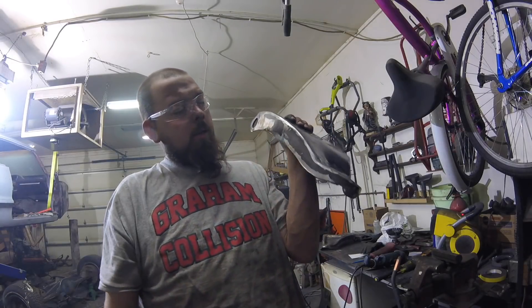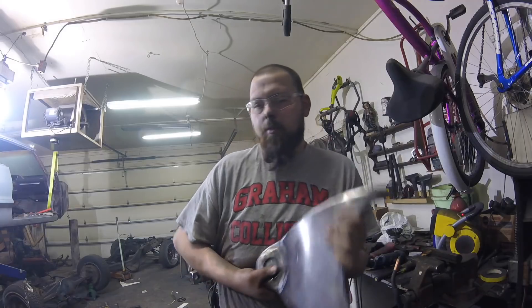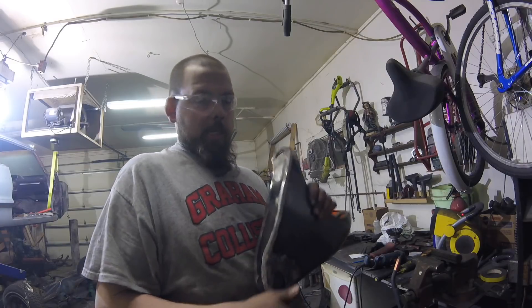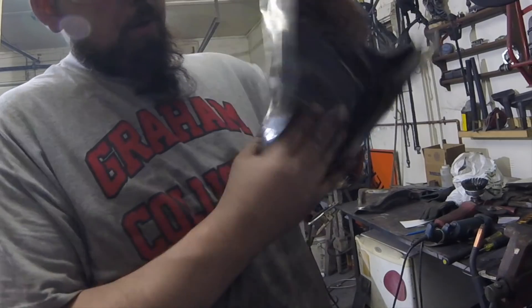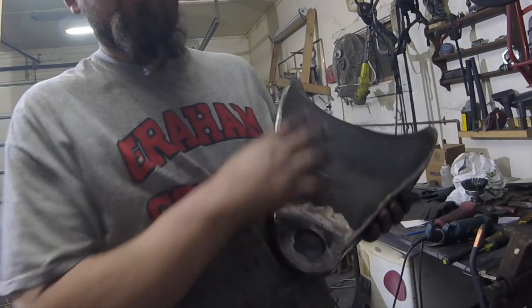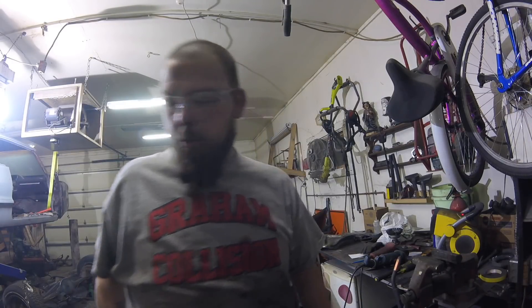For the plating, I basically made a paper template, traced it, put it on some metal, and plasma cut it out. I did a ball joint plate down here, and I also welded up the factory holes because I'm going to re-drill this for a GM — the newer GM style ball joint, like off of the G-Bodies, the unbreakable ball joints.